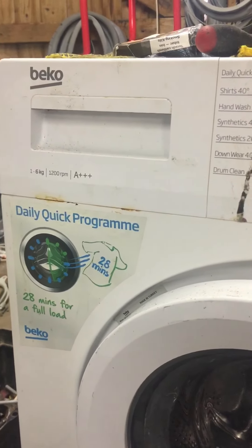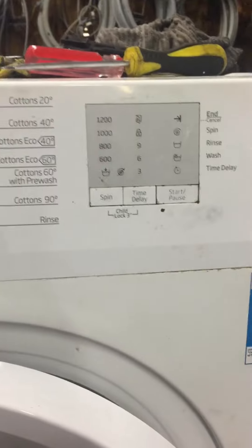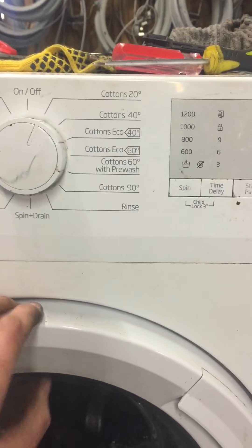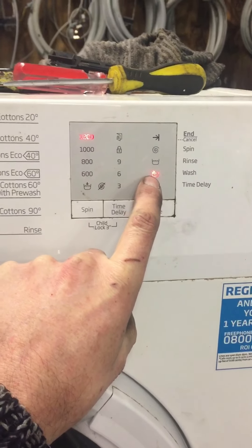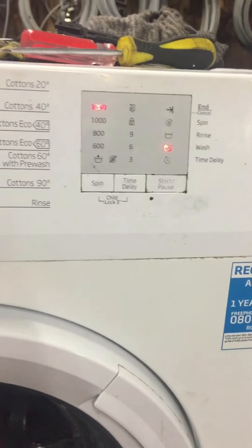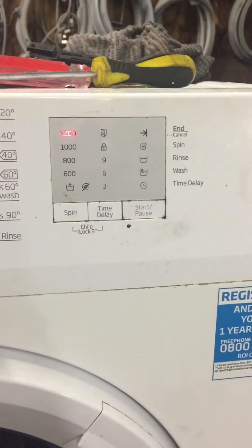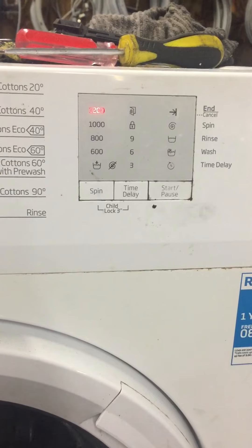In this video I'm going to show you how to repair a Beko washing machine. What's happening is the wash light symbol is flashing and the door activation light is also flashing — it's a problem with your door lock. I'll show you what's happening: close the door, go on to cotton for example, press your start button, you'll see the wash symbol come up. The door is not clicking closed, the wash light symbol starts to flash, and after a few more seconds the door lock activation light starts to flash also. So that's your door lock — that's the issue.